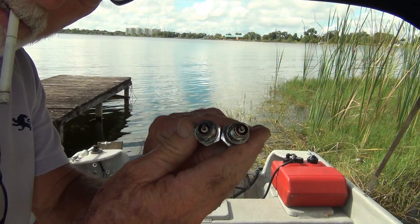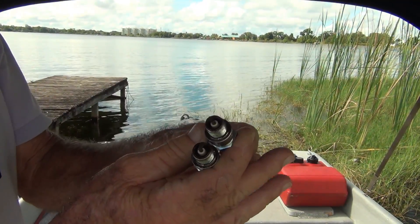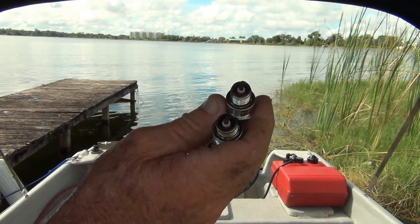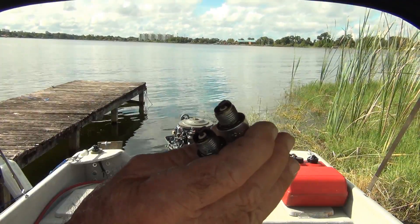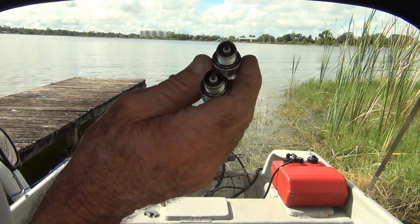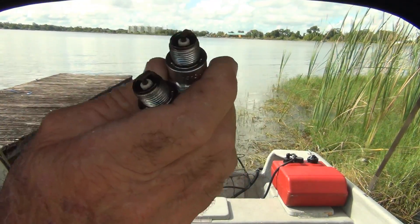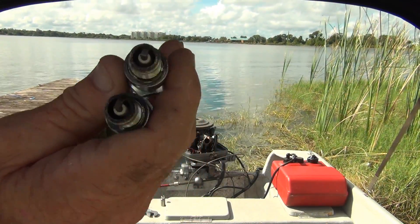That's the plugs that are gapped at 28. They look good, they look close to each other. But they are a little blackish, a little greasy. So I'm thinking, with that gap at 28, not really hitting the hot spot with a bigger spark. Now, you can get too big too and just kill this whole thing. Same with too small. So it's fun with spark plugs.